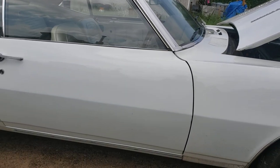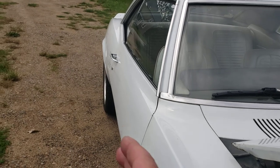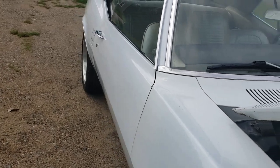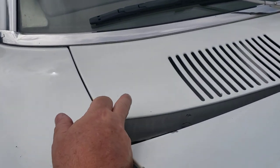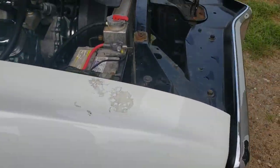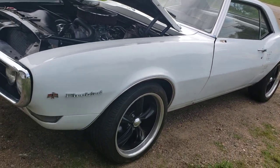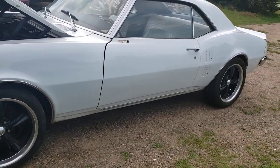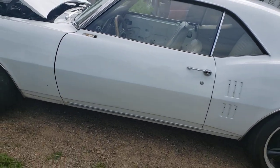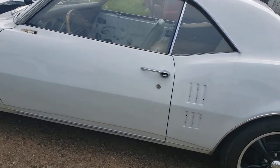The paint is really flat. The door gaps are fair but what isn't really great — go down the top of the doors, the out-the-bottom's in. We're going to align those to the quarters, align the fenders to suit. So instead of just a cheesy repaint like what some shops might do, we're going to blow some of the panels off the car. Before we blow them off we're going to make sure that we can set everything up so that everything will sit flat, because body lines and gaps are important.